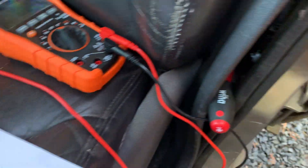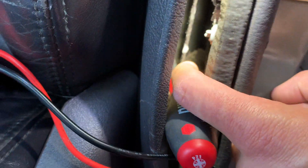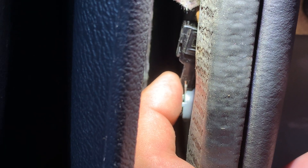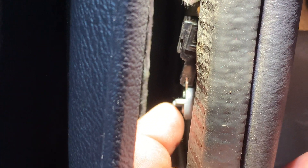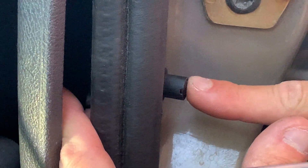Let's go take a look at it right now. I've already kind of pre-opened it up. Right here inside, if you look on my finger, here is the switch and here's the wire coming in. We have that tan wire deep down inside there, going into this connector and then the switch. The top half of the switch is what's coming from the computer; the bottom half is the component ground, just like we saw on the diagram.